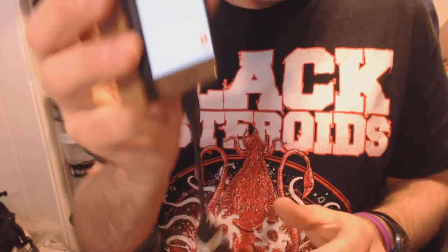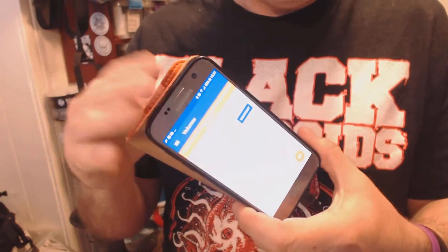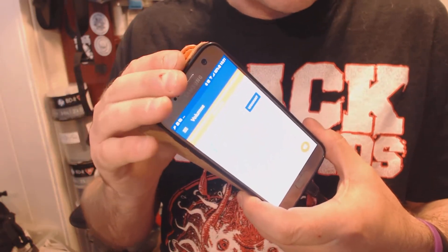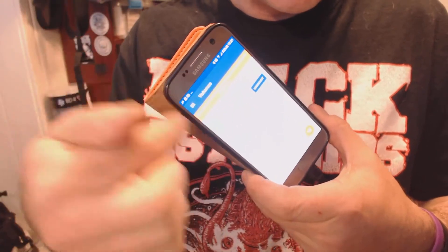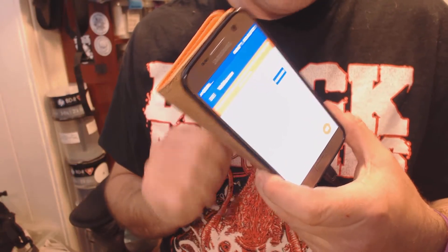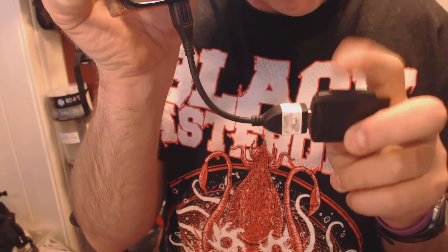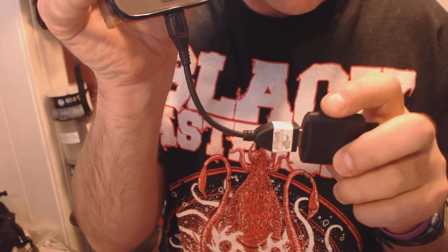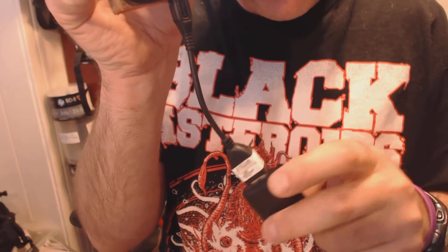But when you plug it in, it will only see FAT32, whereas Android phones will see EXFAT and NTFS internally if you put it into the special internal slot. When you plug it in via OTG, it won't see it, because OTG only sees FAT32 — which means it can't see big files and it can't see your hard drive.